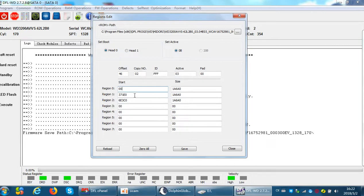We also have the head 1 starting ABA address, and the size of copy 0 and copy 1. Because the two copies are exactly the same, their sizes are exactly the same. What we need to edit here is the starting address. In case head 0 is damaged, we need to set up head 1 as the booting head.